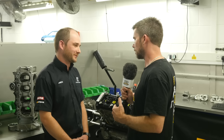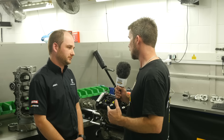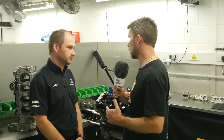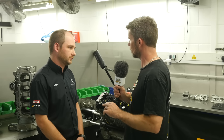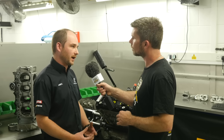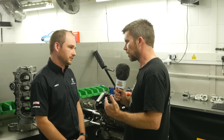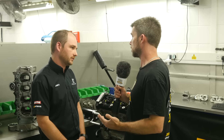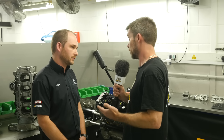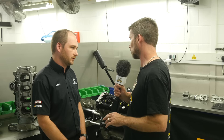Something we don't see in road engines but very common in purpose-designed race engines is that the cast crankcase also includes the dry sump pump as well as the water pump. Can you talk about that integration? We keep everything as compact as possible, reducing parasitic drag. The other benefit of the dry sump system is you don't need the bulk of a traditional sump, so you can lower the crankshaft centreline in the car and get the weight lower in the chassis.